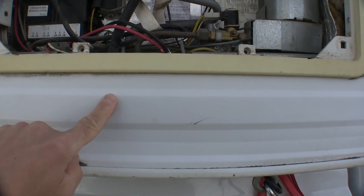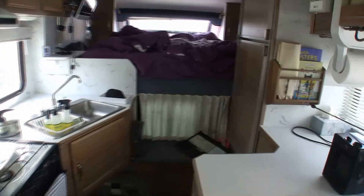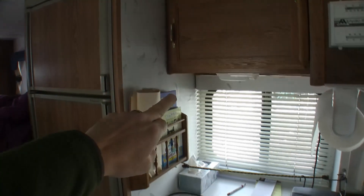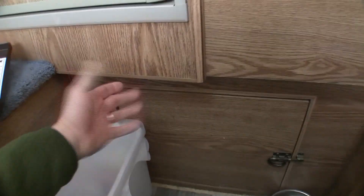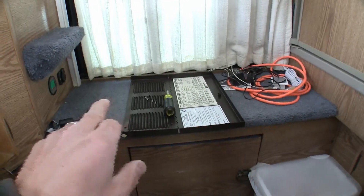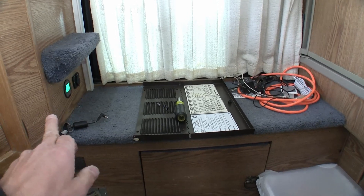I'll go inside and show you what that looks like on the inside. Climbing in the back here to this great big giant camper, which we've really come to love because it has so much room — here's our giant refrigerator. That roof vent we were looking at is pretty much up there above the refrigerator. So those wires come in and follow along the other side of this wall down here. When we look at the bottom of the refrigerator, it's actually open under here. This is accessible to that little space where I drilled, so I drilled that hole and pushed the wires into this little void area. It was really easy to fish them over, and this step on my camper had just a couple of Phillips screws — I was able to hinge that up and continue fishing those wires through into the compartment there.